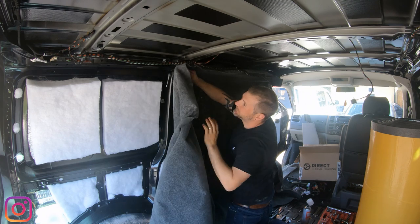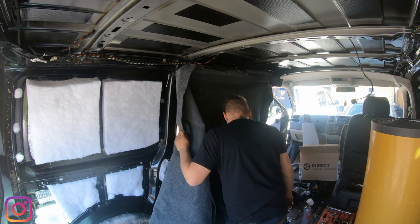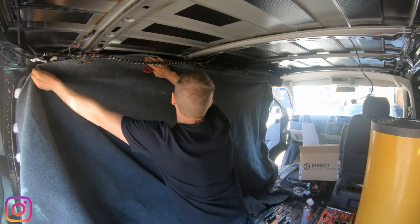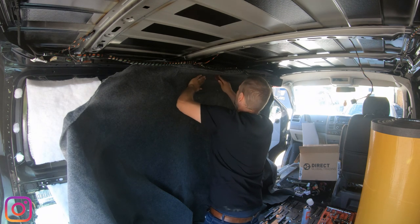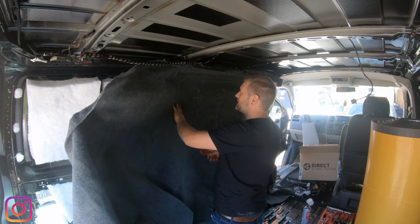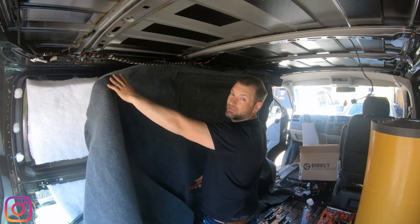And we're here. So again, next bit along there, I'm going to try not to coat the metal, the wiring loom in it, but it's not going to damage it as such. It's just a bit of a pest where you need to try and remove it. So keeping a bit of tension, you can see all the grooves are starting to appear in the van. There you go, there's a bit there. Although I haven't stuck much glue there at all. You see what I mean? You use a trim tool, dig her in, see the line of the van.